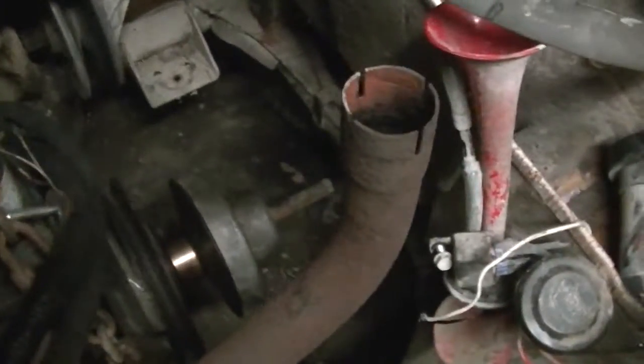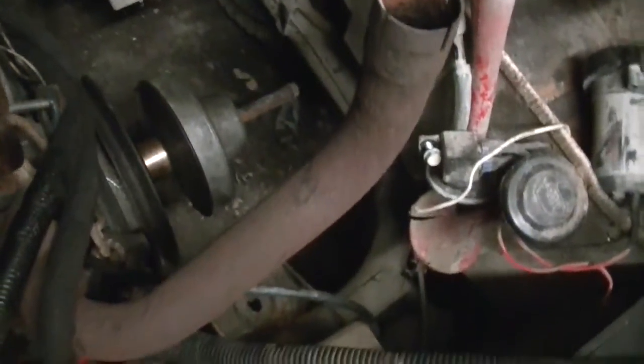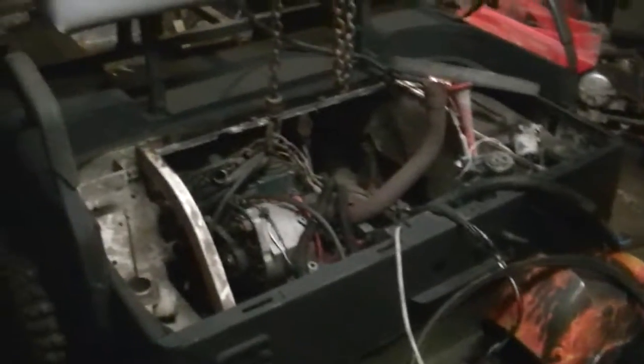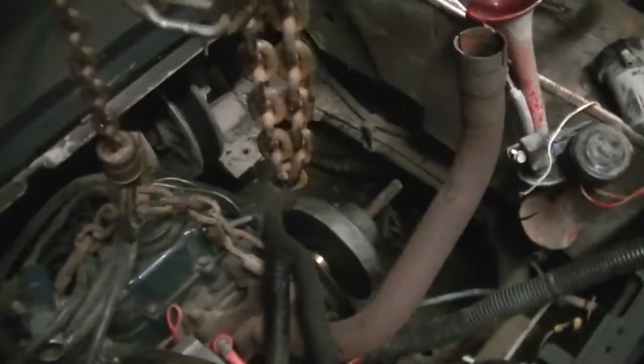But that's the biggest part of it right there, is getting that damn clutch working. I need to get a shorter bolt. The only bolt I had came out of that other clutch and that other engine, and it's a different style of clutch. So definitely got to get a different bolt. The only one I got is like 4 inches longer than I need it to be. So I gotta go to the hardware store, which will be tricky because not only is it metric, it's fine thread, and the hardware store around here ain't real fond of fine thread stuff, especially metric fine thread. But we'll see what happens. I don't know exactly the size bolt I need. I may get it just a hair longer than I need to, then use some washers, but I don't need it quite that damn long.